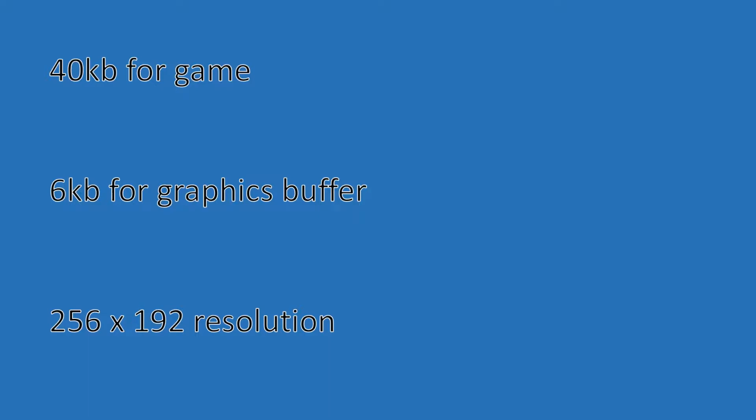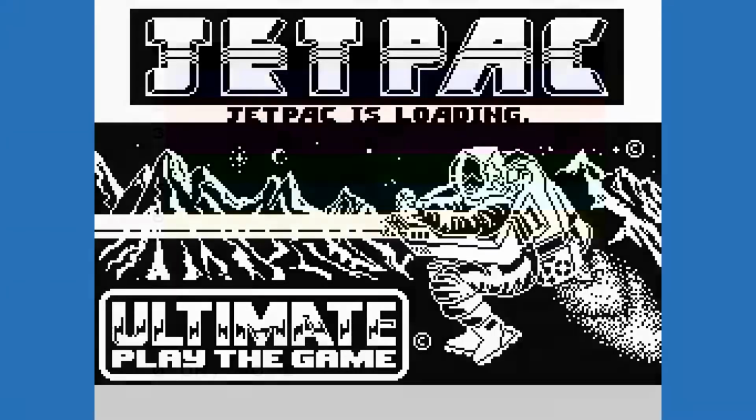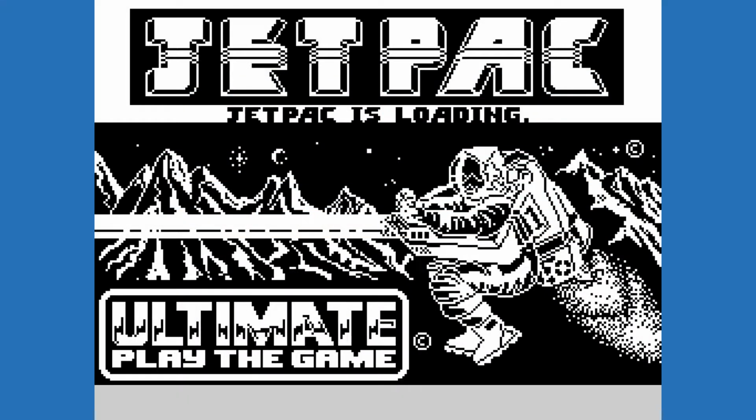This small amount of RAM gives us enough bits so we can have a single bit for every single pixel on screen, which effectively gives us 2 colours, so we can make some really nice black and white artwork. But we know this machine was capable of colour. You had at least 8 colours and then 7 more highlights. So how do we get from that black and white image to a full colour screen with only a few more K of RAM? Well, this is where the Spectrum's attribute memory comes in.